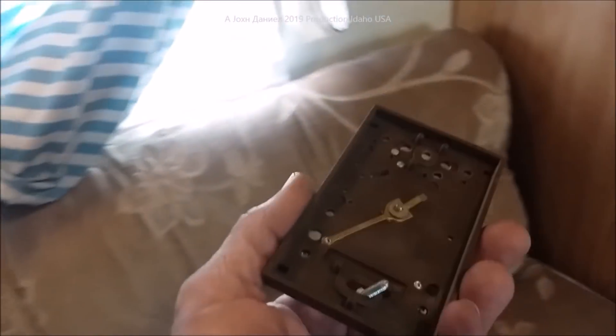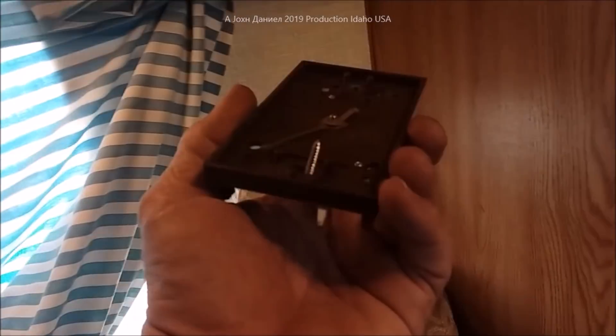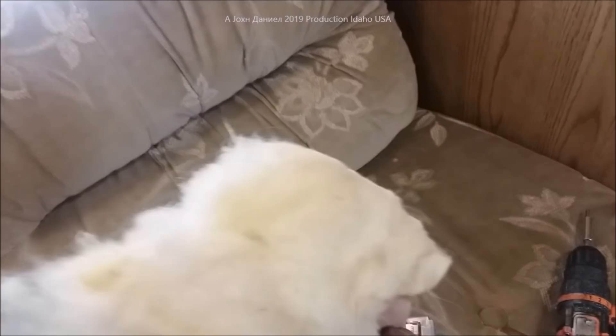One important thing a lot of people get wrong when changing out a thermostat in an RV: your walls are thin. Cold from behind the wall — you can see all those holes — will affect the thermostat reading. Even if you set it to 75 degrees, it might never get above 60 in the RV because the cold transfers through. One of the best things to do is put some fiberglass insulation behind it to isolate it from the cold.